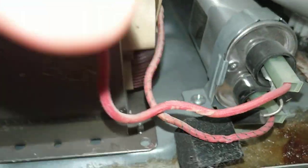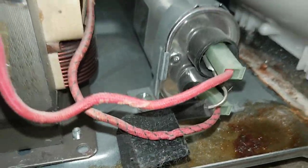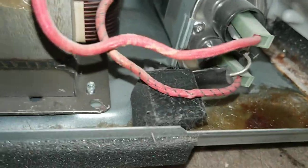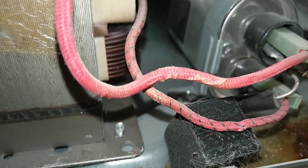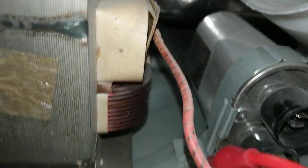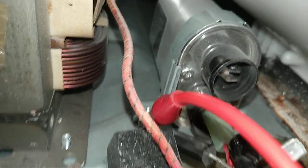There's the fan that still runs, the fuse, a couple other things, door switches, and the control panel. Let's see if I can source a diode for it. Meanwhile I'll discharge this capacitor so I don't get electrocuted. I also need to note the wiring diagram of which wire goes where so I know how to reconnect it. I haven't discharged the capacitor yet but it seems pretty much safe as long as I don't touch the terminals — they're well insulated.